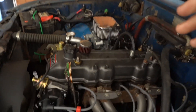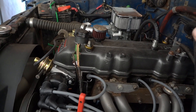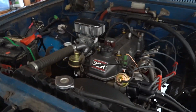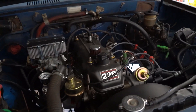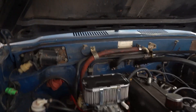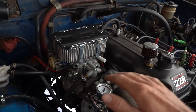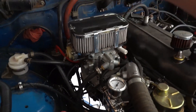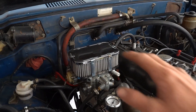The issue I'm having is while running, if it gets up in RPM it purrs smooth like a kitten, but if I put it down to idle — anywhere from 800 to 1200 RPM — it's a really rough, shaking idle. I have cleaned the carburetor about five times now, completely gone through it, adjusted the float, made sure everything's clear, everything's airtight both on the intake and all the gaskets on the carburetor are solid — I have no leaks whatsoever.